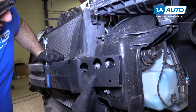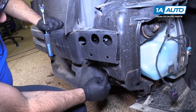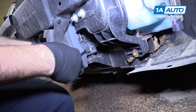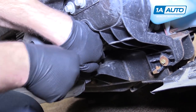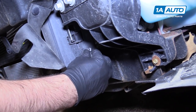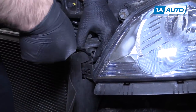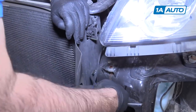There's a rubber air guide on each side of the radiator — you need to unclip it. It's got three metal-style push clips. I'm going to use our trim clip tool, kind of slide it under there and pop it off. They're kind of one-way clips — just work them off with a little bit of force. If they get mangled, don't worry about it; they'll push right back on and lock in place again. Just repeat that for all of them. The same for the one that's kind of in the middle here — it's hard to get to.